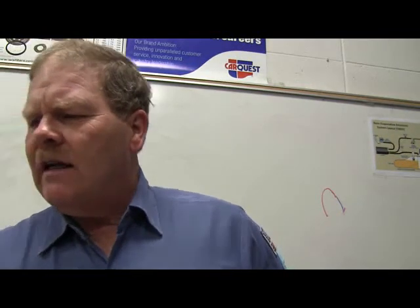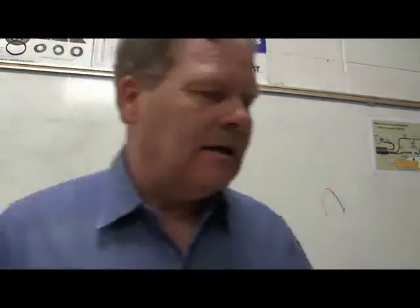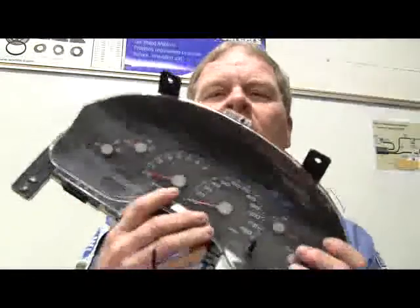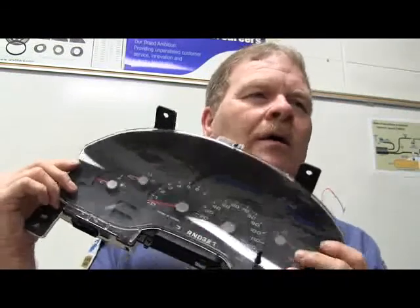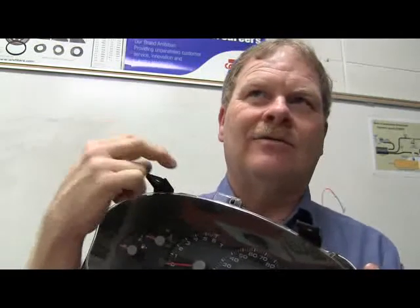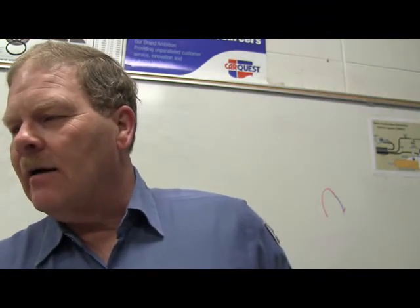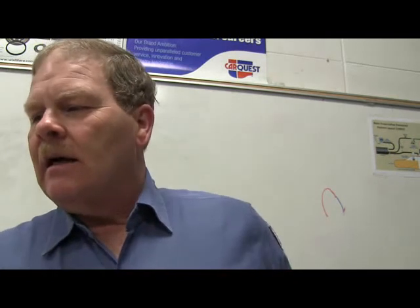Okay. Now then, let me see here. Number 17, the bulb in an automotive warning lamp is made of tinted glass. Right? Wrong. Is it made of tinted glass, tinted plastic? That's a screwed up question the way it's done there. Mounted behind a colored lens, surrounded with reflective metal. Look at this, guys. You see these warning lights on this thing? They're going to burn all different colors. Do we have a bunch of different colored bulbs in there? No. We got a white bulb all along behind a piece of plastic. The only bulbs that have any kind of tint to them at all, a lot of these instrument cluster illumination bulbs, will actually have a little plastic tube-looking thing on them to give a lower tint, like a blue color, so that they're not going to annoy you and shine in your eyes when you're driving down the road. But anyway, it's mounted behind a colored lens. That's the right answer for that. That's B, I guess. I think that's right.